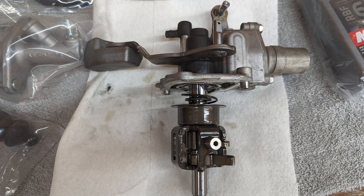Here's the shifter assembly. There is a bolt that you're going to take out, and this is going to release the springs that are circled here. Just be very careful to keep everything contained and keep constant pressure on it — you should be fine.